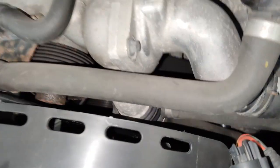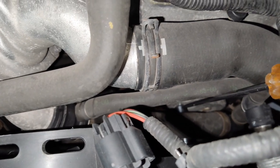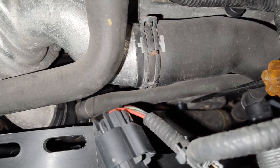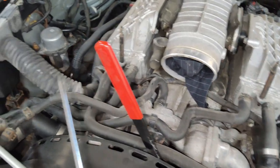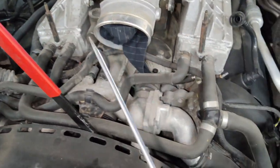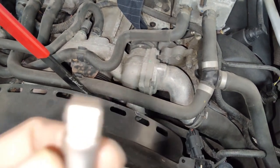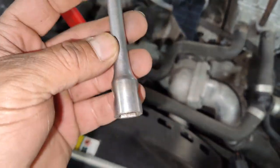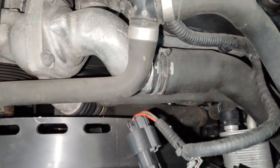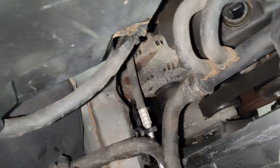We're not undoing the supercharger belt — we're looking to remove the belt from the alternator. You can see my extension going into the tensioner, and I have my belt tool attached to that extension. Moving it toward the right of the vehicle will lessen the tension on the belt so we can remove it off the alternator pulley. On the end of the tensioner it's just a square drive for an extension. I was able to attach the belt tool to a shorter extension and attach it to the tensioner to loosen the belt from the alternator.